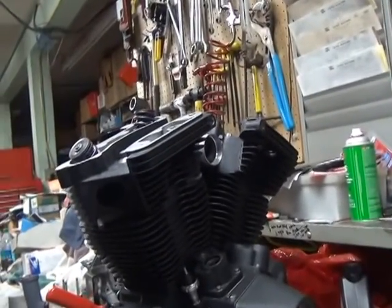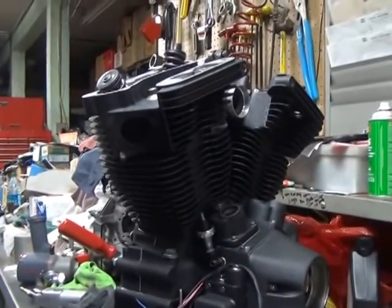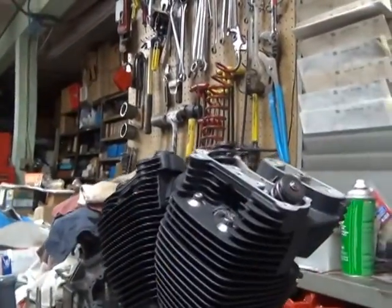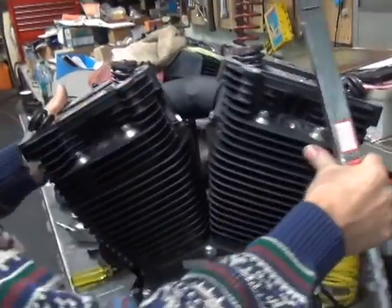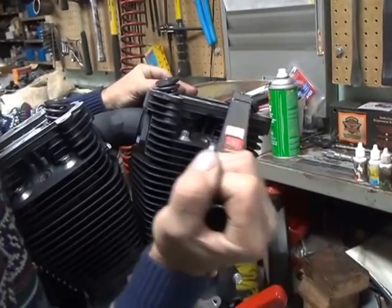And I bumped this up to 40. Stock stuff, you go 36, 38. S&S cases, you can pull them 40 to 42. I know that could go more than 43. You can run as much as 45. Anything past that, you'll strip studs out. But stuff starts getting really soft in the 42 area. So